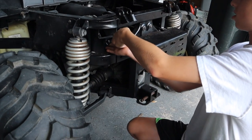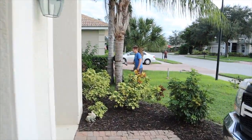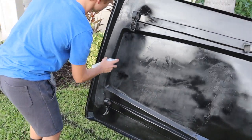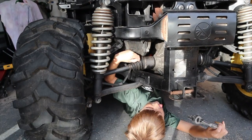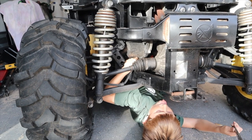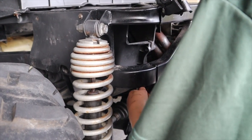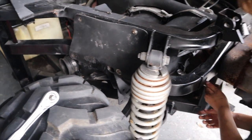I've got Colin working on it now with two more bolts to get off. Gavin's been vacuuming up on the cart, and Micah's doing some touch-up where we did the fine sanding - it's looking pretty good, not going to be perfect but a lot better than it was. I've got Gavin underneath as my little mechanic getting into tight spots under the clutch cover to get the last few bolts out. There's something wrong with one bolt - it's stuck. I checked my service manual and I do have to remove that bottom skid plate, which I was hoping to avoid, but it's got to come off to get to the clutch.